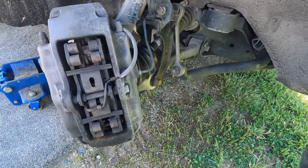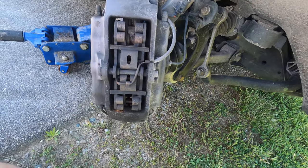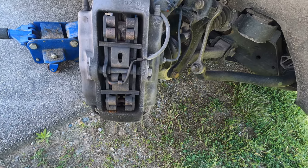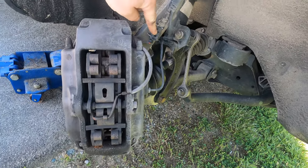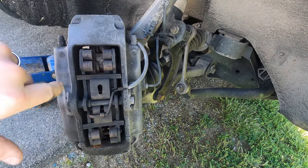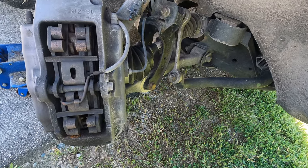Here's the pads. It looks like this is the same as I'm used to seeing on motorcycles and stuff — maybe all the newer cars do it. I should just be able to pull this top pin, unplug the sensors from here, slide the pads out, push the pistons, and then slide the new pads in. We'll see how well that goes.